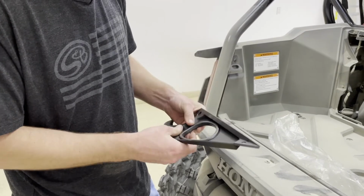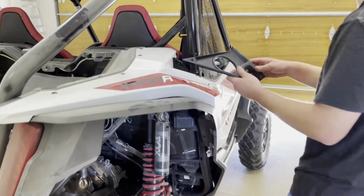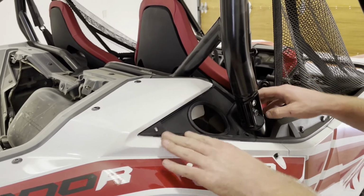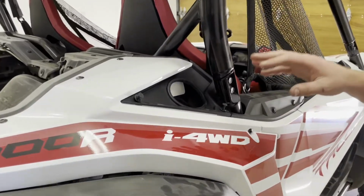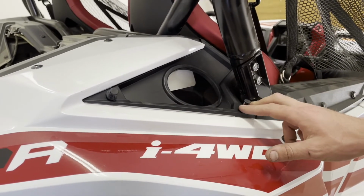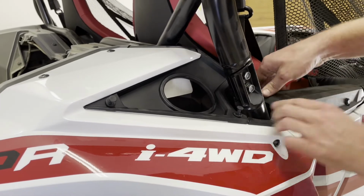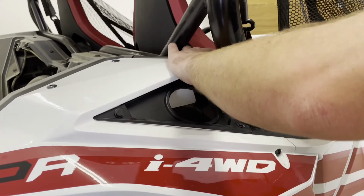So with that grommet there, we can come around to the vent hole here. And this will install just like the factory one did with the push clips and sit nicely into place. So I'll get those push rivets installed now. I'm going to re-secure our new cover using 4 push rivets. The old vent cover used 5. We're going to dispose of one of those push rivets. You can keep it as an extra if you lost one or broke one during the install. So there's going to be the one up here. We'll just go ahead and get these clicked in. I've already placed them into place. We'll get them engaged.